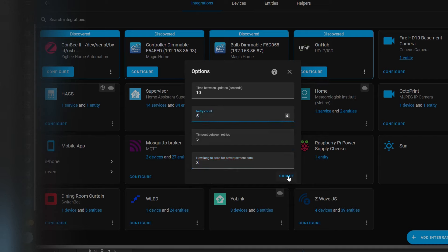The big issue I found was with the set of curtain motors furthest away from my Home Assistant hub. Sometimes the cover wouldn't respond at all to open or close commands — instead I would get an error that said 'failed to call service, Bluetooth command failed.' I determined this was because those two curtain motors were the furthest away from my Bluetooth dongle, which shows that Bluetooth range is something you want to consider if you're looking at this product.